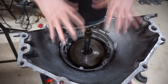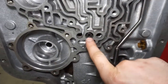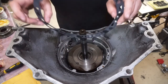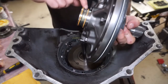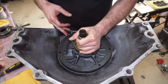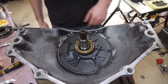So next we do pump gasket and pump. Before I do the pump, I put the center support bolt in just to make sure everything is in the right position — if that's not seated right, it's going to push everything forward a little bit. Got that in there, made sure that's good and tight. Put the pump gasket on — I did take some assembly lube and stick it on the backside of the gasket just so it sticks down and doesn't move around on me. I'm going to put some assembly lube around the sealing rings here, put it down over the top, and eyeball the holes as I drop it down. I want to say these bolts are like 18 foot pounds.